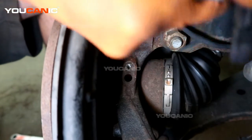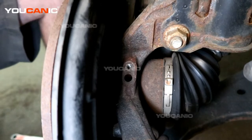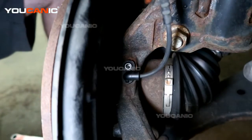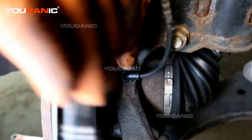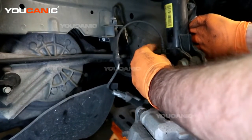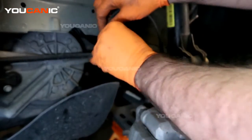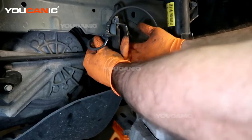The key is getting the sensor piece out without breaking it off. When you have the new one, replace it in reverse order — take the new sensor, press it into place, then put the 5mm Allen bolt back in and snug it up. That's all the torque you need. Then run the cable up, put the grommets into their holders, and make the electrical connection again. There we go.